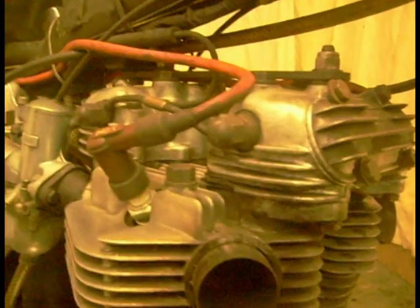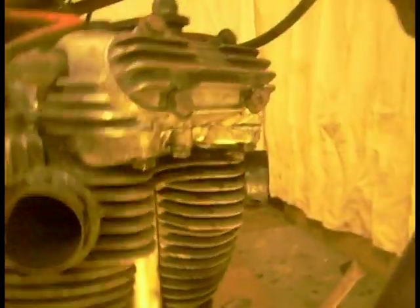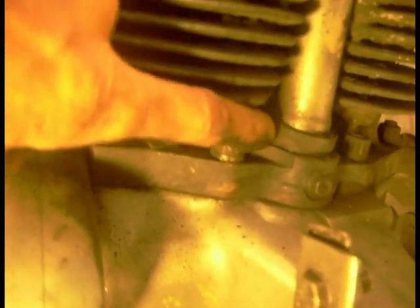I haven't cleaned it off. The reason being - if it's leaking oil, you can see where it's coming from. I've got a little oil leak here. Now I know these threads are iffy, so I'm going to be putting some Timeserts in them. I think one of the base ones is as well. Nice dry pushrods, but that ring has kicked up again, which is totally mad. Bit of oil vapour, not much.